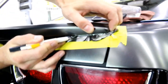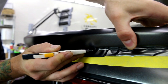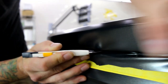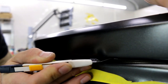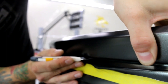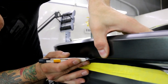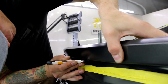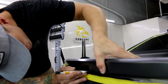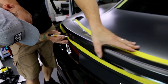Going across the bottom now. If you're wrapping your entire car I recommend wrapping the trunk first — this will also prevent you from cutting into the paint by having an extra layer of wrap there as a safety measure. My blade is always pointed up, but as a beginner you may not be totally comfortable with a blade yet, so that'll give you added assurance.